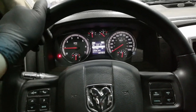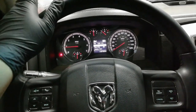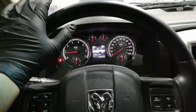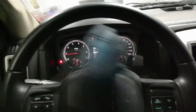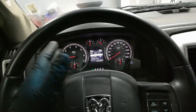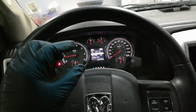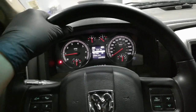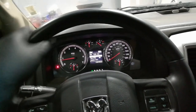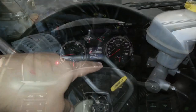So what good is fuel and spark if you don't have any compression? What I'm going to do is pop off the valve cover and actually start it running only on the passenger bank - cylinder one is on the driver's side at the very front. I'm going to look at the valve springs to see if they're opening all the way, because these do have a known issue of wearing down the camshafts. Let's tear it apart and see what we can find.